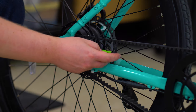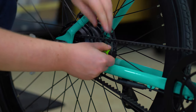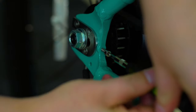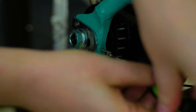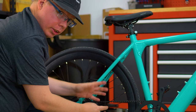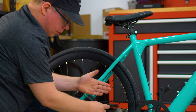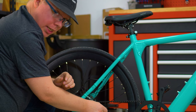So as discussed, this belt is too tight, so we'll simply want to turn it. To decrease the tension, you're going to want to turn counterclockwise when facing the bolt, or clockwise to tighten it.